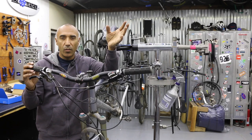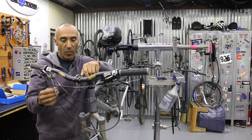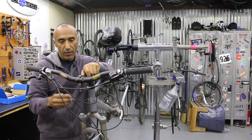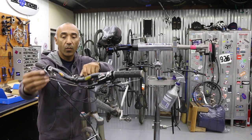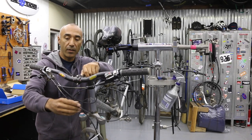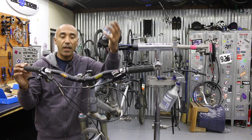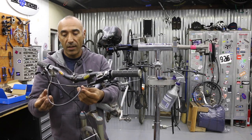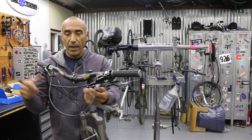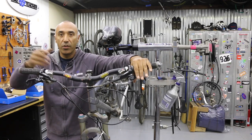That's about it — a nice bolt-on system with pre-bled brakes. You can buy those almost anywhere and most brands come that way nowadays. We just have some excess: the front line is not terrible, but the rear is pretty bad — definitely need to take off at least six inches. But if you had to go ride tomorrow without cutting it, you could just zip-tie everything so it's not flopping around and go out and ride.